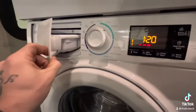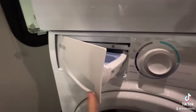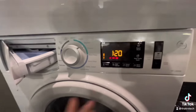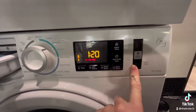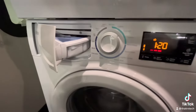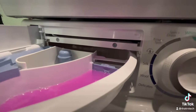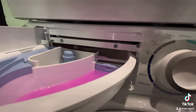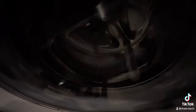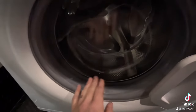After that, all you're going to do is crack open your detergent tray here. Once you have this open, it allows you to see the water coming in — you want a visual of the antifreeze coming through so you know it's gone through. Start your cycle. It's going to do its sensing, and then it should begin filling the washer. You'll have multiple streams of antifreeze back there indicating both valves are open because you're on warm. Make sure a decent amount of antifreeze gets in — at least enough to see it start pooling up on the bottom.